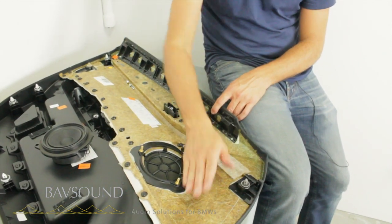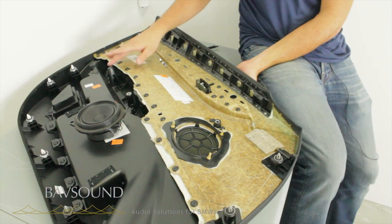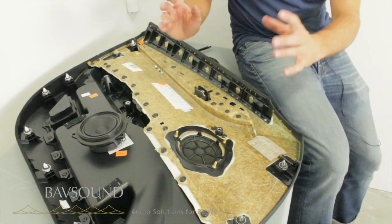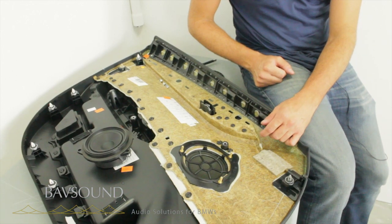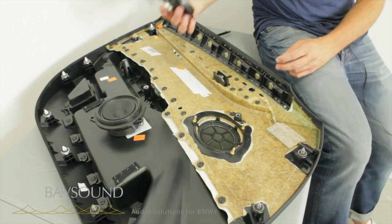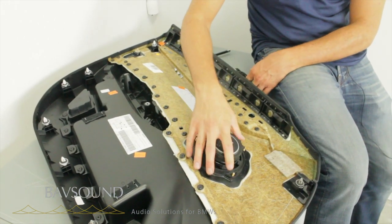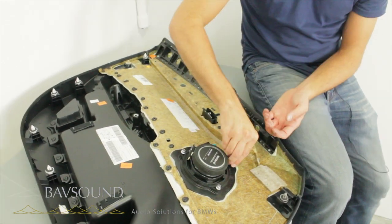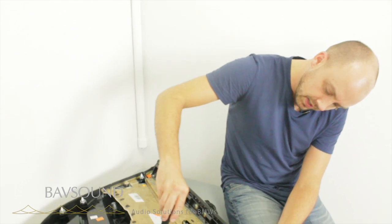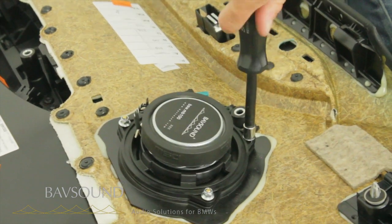Basically you would cut the sound deadening and adhere it all over this panel and all around here, because we want to control the resonance between the driver and the rest of the panel. Take a uniform piece, apply it here to bridge the gap between these two surfaces. Do the same thing all along here and through here. Obviously we don't want to cover up any holes — specifically these guys up here and these three here. Use half of it on the left front door, half on the right front door, and you will have beautifully, brilliantly dead panels for maximum mid-bass performance. So with the factory driver out, we take our driver and just drop it down like so.